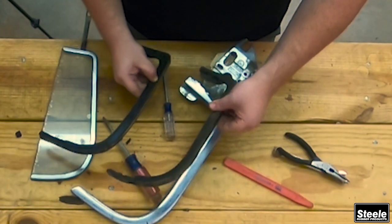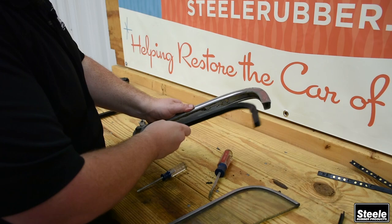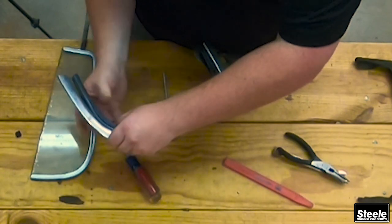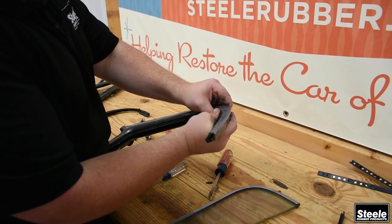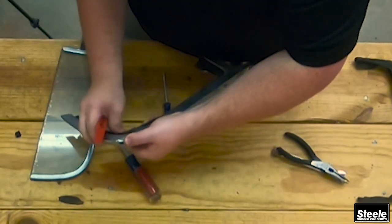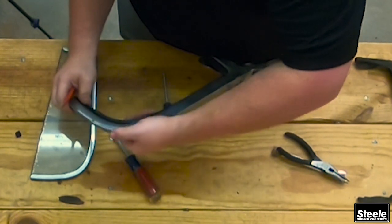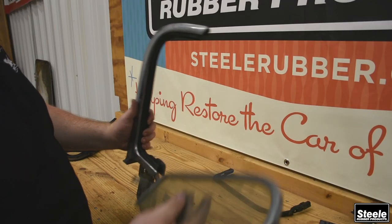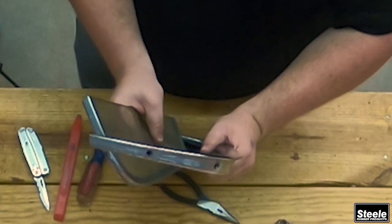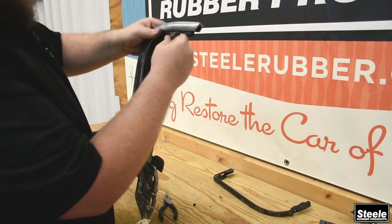This is the one we're replacing it with. As you can see, it's an exact copy of the original. Just like that other one, it goes back in just the way that one came out — that slides into place, this pushes up into the top, and then we can set our screws. Now that we've got our rubber in, the glass goes in just the same way it came out. Turn it 90 degrees and press down until it pops into that pivot place.